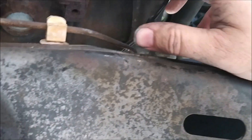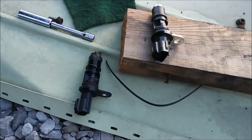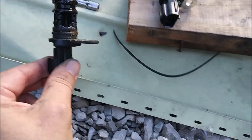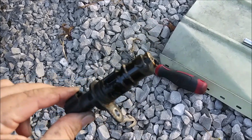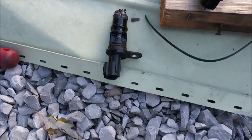It's a three-prong connector. If we squeeze and pull — it's held in by what appears to be a little 10mm bolt right there. Here's the old one and the new one; they do look the same. Now it is possible the old one still works, and that all this magnetic gunk buildup on it — which I'm guessing are engine components made of ferrous metal — is causing the issue.